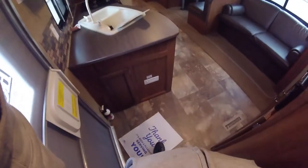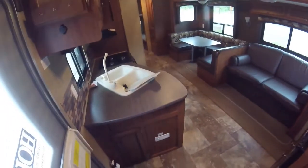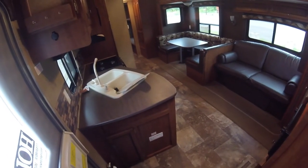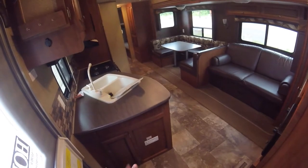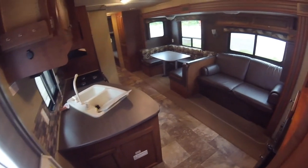On the side of the kitchen cupboard down here, you have your propane and CO detector. That's wired straight to the battery on the trailer. If the battery on the trailer becomes low, it emits a high-pitched squeal to tell you it's not going to work properly. If the alarm does go off, the corresponding light lights up to tell you if it's detecting a propane leak or carbon monoxide.